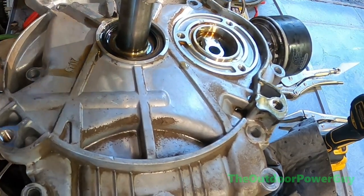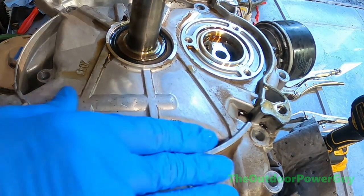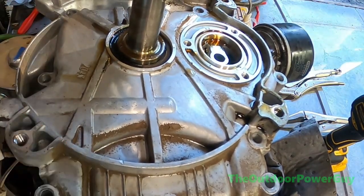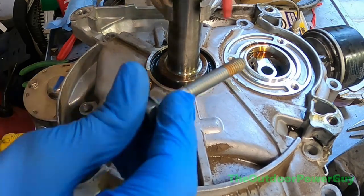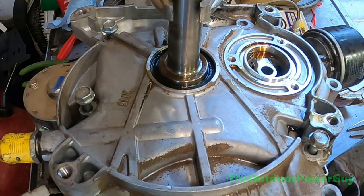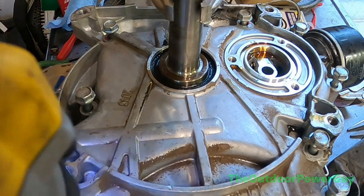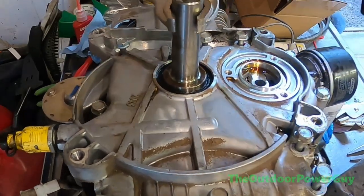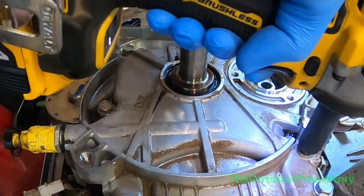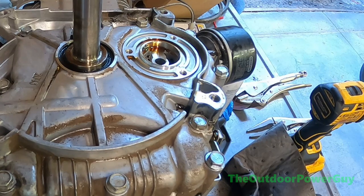Nine out of ten times oil seals will not roll if you use enough lubrication — I just use straight engine oil. Down goes the pan. When the pan goes all the way down it means everything's lined up. We're putting some Loctite 272 on the engine bolts, then running them down with the impact. I'm going to run these bolts down with the impact because it is a whole lot faster than doing it with a ratchet or torque wrench, on the low setting so it will not impact the bolts. Then we take a torque wrench and torque everything.